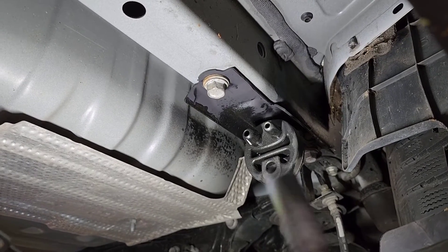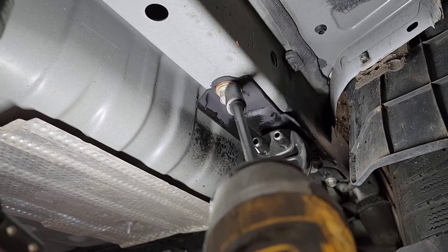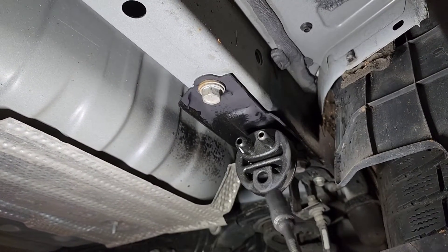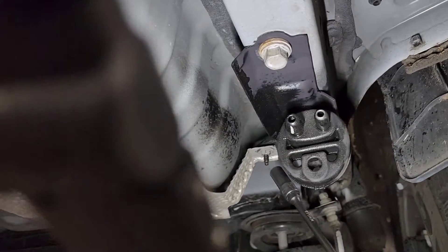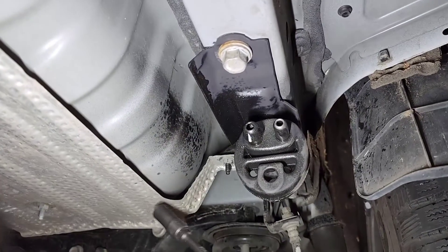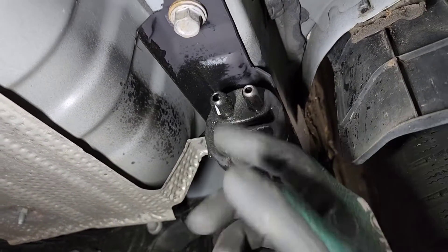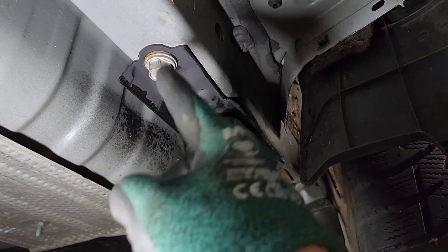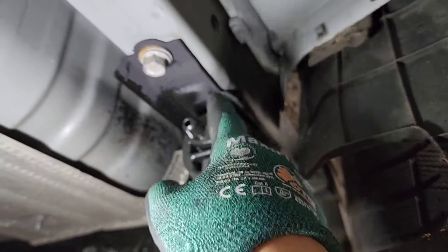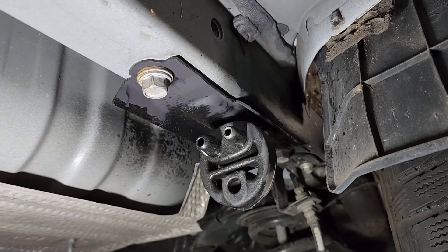If you're wondering how to remove that plate — because it's easier to cut off the vehicle — you just remove this bolt right here which is 17mm, same thing on the back side, and then there's a 10mm right here that attaches to the heat shield. You loosen that, pull this down, loosen the two 17mm bolts, and it should come off so you can cut it better. After I cut it, I sprayed a little bit of black paint so nothing is exposed, just in case it gets corroded or rusts.